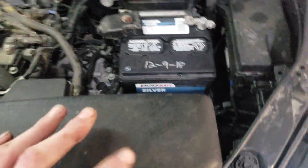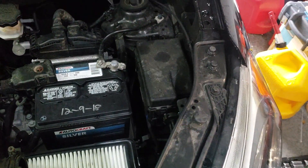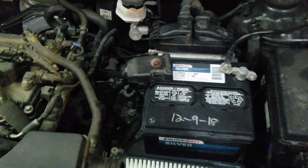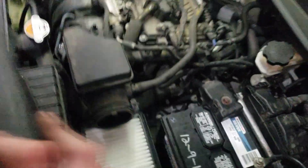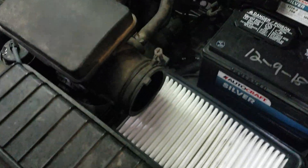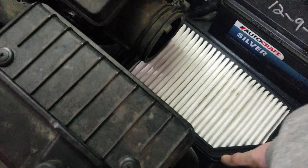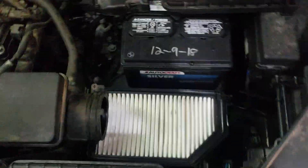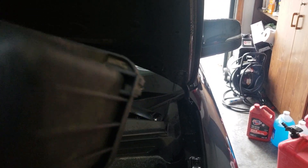Now you can put everything back in place. You do not have to take this completely off the hose if you don't want to — all you have to do is lift it up, hold it up, take the filter out, put the new filter in, then just slide it back into its groove. Make sure you've got both of these tabs — this one here and that one there — inside the groove first before you're able to close it. Don't forget to also lock the filter. You've got the tabs here, and if you can't get these tabs on, you probably don't have the tabs back here lined up. Push it in all the way so you can lock it — that tab just kind of goes over that little stump there on the corner, and that's what holds it into place.